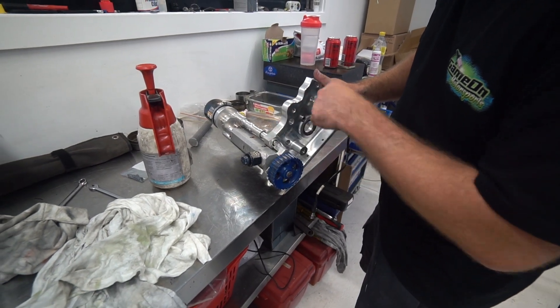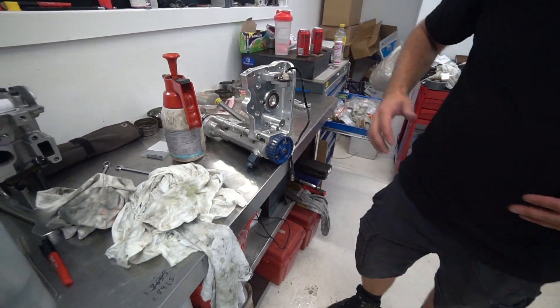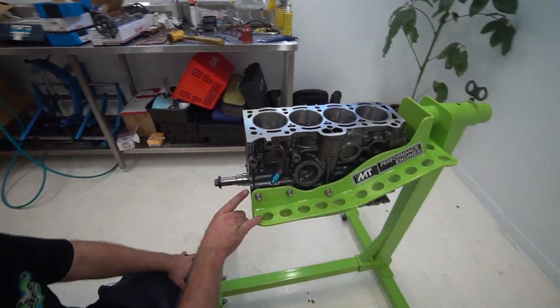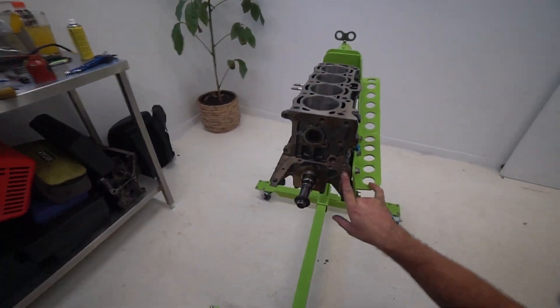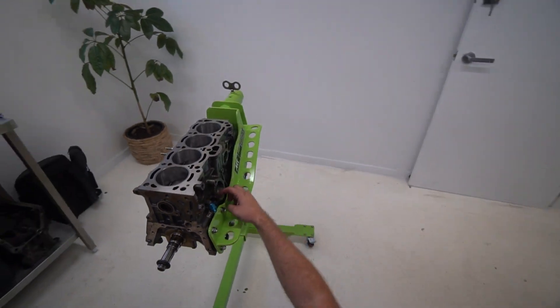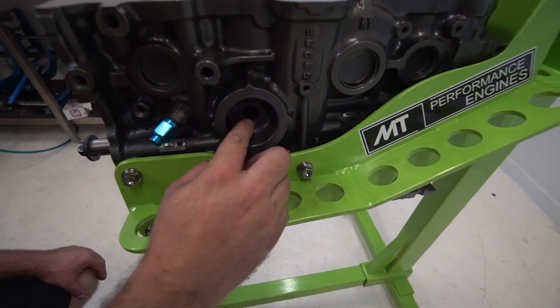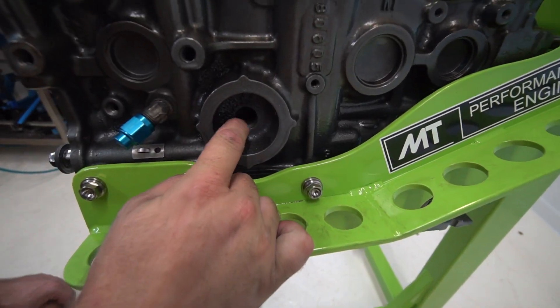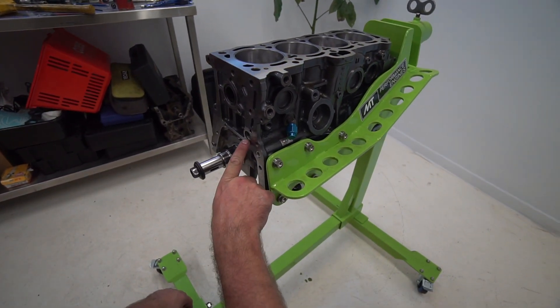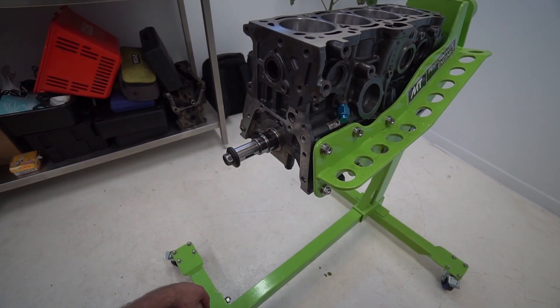Basically this is where the old pump would be — now it's just a seal holder for the oil pump system. It doesn't actually drive the oil pressure through the normal channels. Normally the oil pressure would come through the pump into this gallery here, travel through into the oil filter housing, but it's been blocked off. This fitting here is now the turbo feed, which would normally get blocked off in a Formula Atlantic engine. Now they actually feed directly into the main oil gallery.